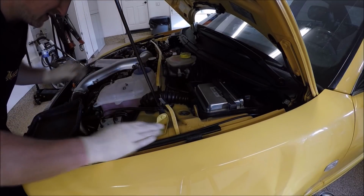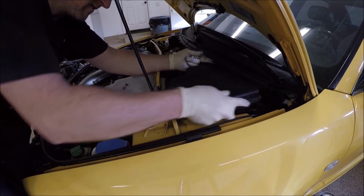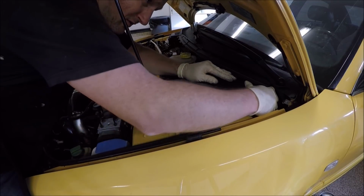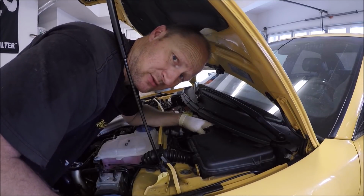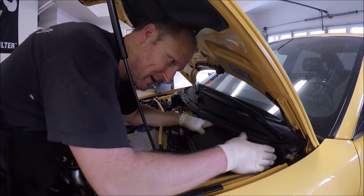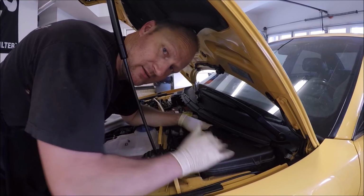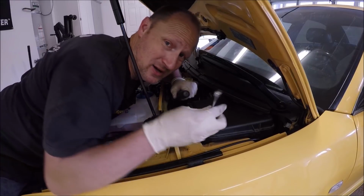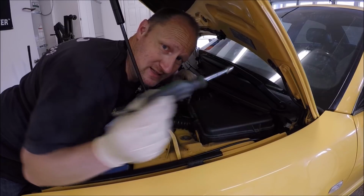ECU is in. Put the top on. A lot of guys do not put the bolt on that's back here or the one on the side here. That's how you can tell an amateur from a pro mechanic. You'll go to these cars and look at them and it'll be missing the 8mm bolts in the back on this ECU cover. Put them on. It also helps to have the right tools. An 8mm gear wrench works wonders. Same with this.